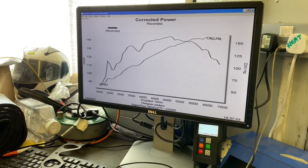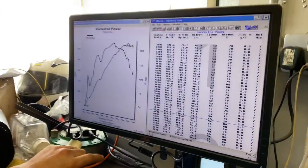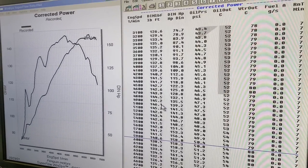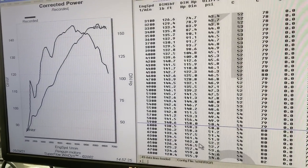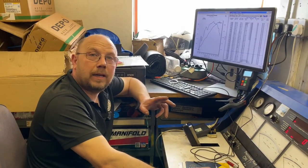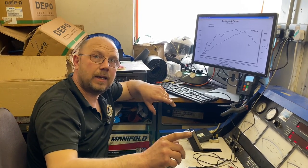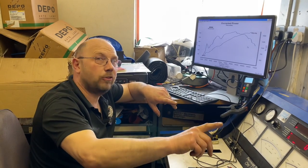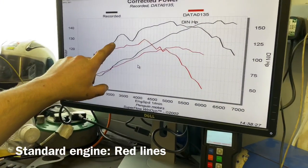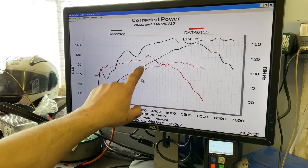So let's see what we got — there's the first power run of the day. Let's have a look at the actual torque numbers. First test we pulled out a peak of 146.1 pound-foot torque and a peak of 162 horsepower. To put that into perspective I'm now going to get it up on a graph and overlay a graph of a completely standard engine with the same intake and exhaust system, so you'll see the difference that the head work and the cam made. From 3,000 rpm on upwards, big gains in torque and obviously big gains in horsepower.